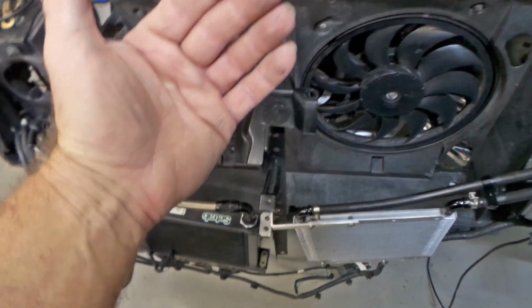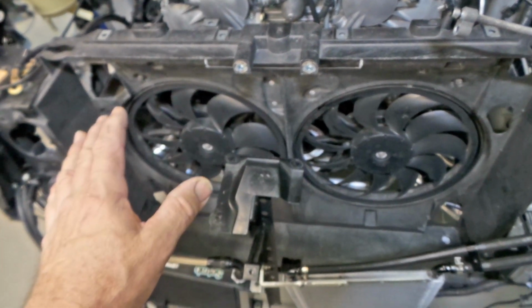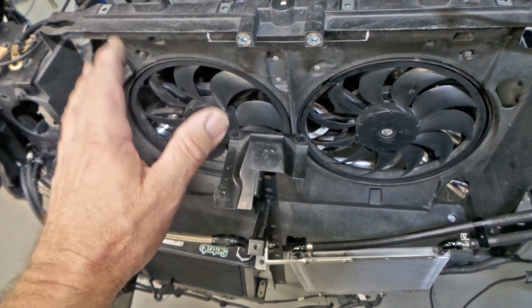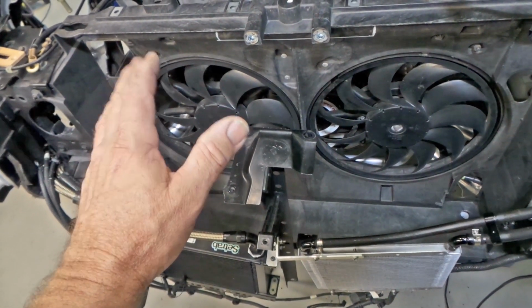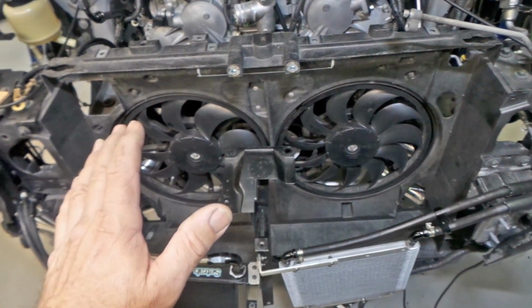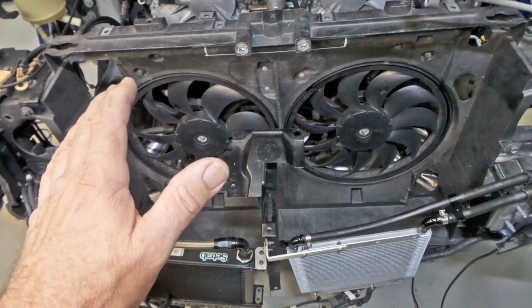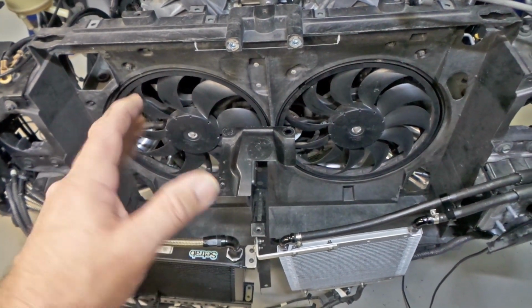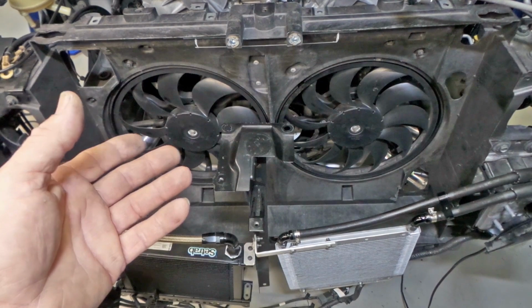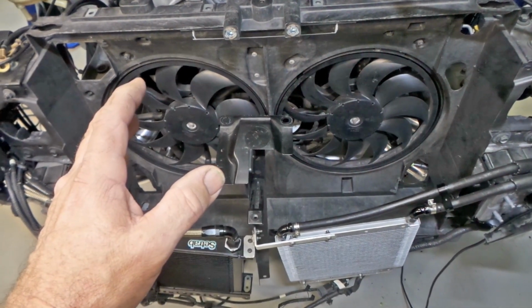of the radiator, which, as I say, allows me to fit it, but I think over time it's going to stress the core and possibly cause the radiator to leak, crack, whatever. At this stage I want to do everything in my power not to put this radiator core under any kind of stress, so that it can perform its job without having to fight against a twist or something pushing against it, which is going to cause it to crack.